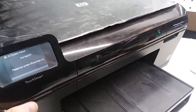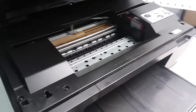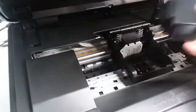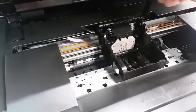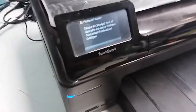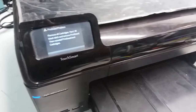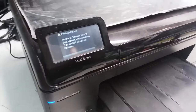What I would first do to resolve this issue is open the ink cartridge area. We're going to remove the ink cartridges and remove the print head by lifting this latch here. I'm going to close it just to see if the problem went away — and now the error is gone, it shows me the print head problem. So what I'm going to do is clean the contacts on the print head and on the carriage unit that it connects to.